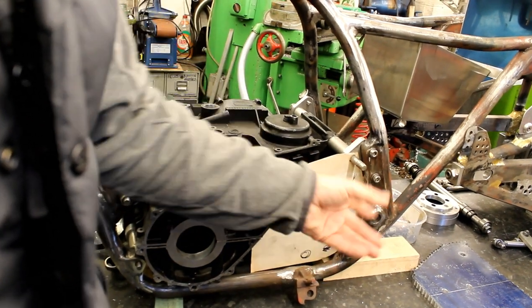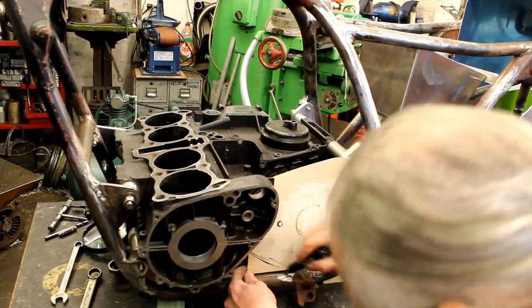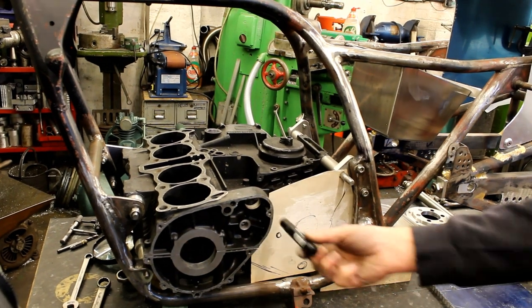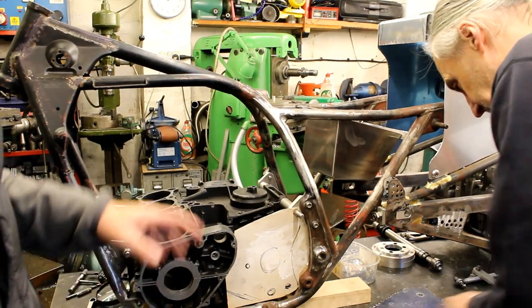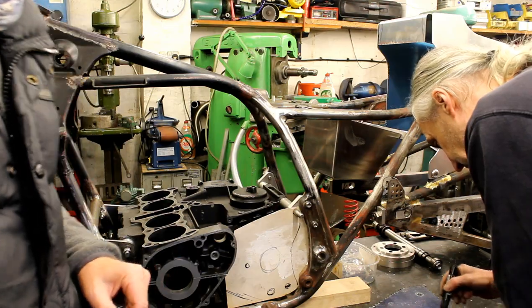Getting everything to roll perfectly is the difficult bit. With about half an inch - twelve point seven millimetres - that's going to be sitting roughly there. When I did Leslie's bike it was shaped to that and then finished and curved round. You've got to clear the starter motor. We could draw it on, put a spacer across - go up like that and leave it. I'm happy for it not to follow the line; it can be straight lines rather than nice curves.